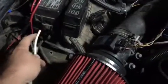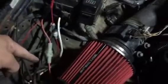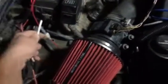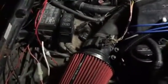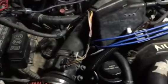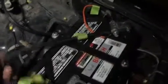The fuse box was another thing I bought from Off-Road Solutions. You'll have to run power from the fuse box over to the battery — theirs uses about a six or four gauge wire to do that. I'd actually just buy the wire yourself because I overpaid for it. Same thing with the battery harness — Off-Road Solutions did a good job, but if you have the factory battery harness for your vehicle, save it and use it.